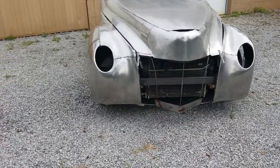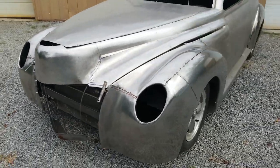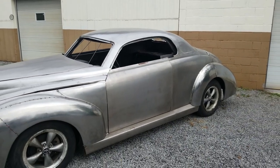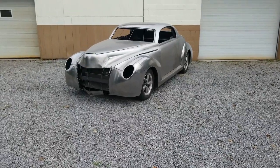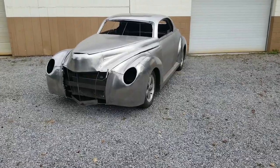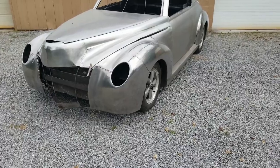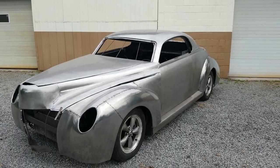You're probably going to ask me what the next step is. Well, we're going to get it back in the shop — that's the first thing. Take, blow off all the exterior panels and then pull the engine out. Transmission, drivetrain, all that stuff — take it out — and get the chassis up on a rotisserie. Then we're going to detail the underside, finish all the welding, finish all the grinding, paint it, undercoat it. Once all that's finished, we'll get the exterior panels mounted back on, and as we're mounting them we're going to be fine-tuning them to that structure. We still have to finish all the welding, get all the flanges made, all the bolt locations, fastener mounts — all that done. We're only at about 40% with this build. There's still a lot of work ahead of us, but this is a huge milestone.